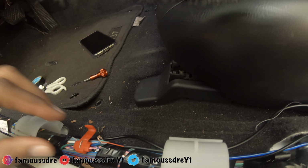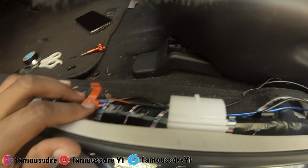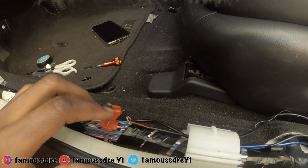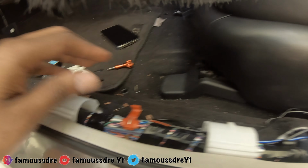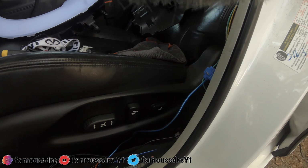And once you do that, I have identified the right places. They both were the right places, there just wasn't enough wire on the inside showing. So make sure you got a lot of wire on the inside showing. So make sure it's none on the outside though. You never want any extra strands to be out, because if it touches anything, it can short circuit. And same with this.